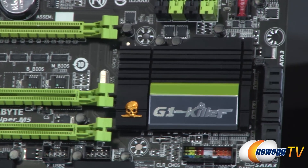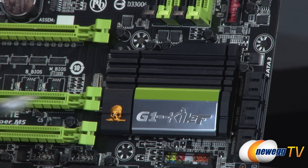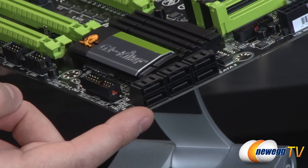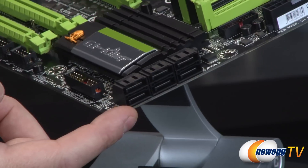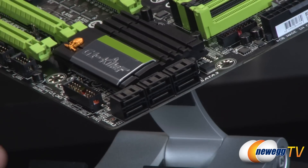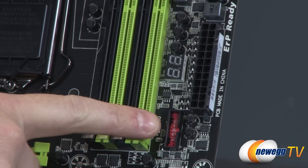To the right is the G1 Killer logo heatsink featuring the G1 Killer skull, and a nice fat heatsink for the Z87 chipset. One of the really cool things about Z87 is that all six native serial ATA ports are now SATA Rev 3 at 6 Gbps, so you can max out six SSDs all running at full speed. You also get RAID support — RAID 0, 1, 5, or 10 — all natively controlled by the chipset for really good performance.